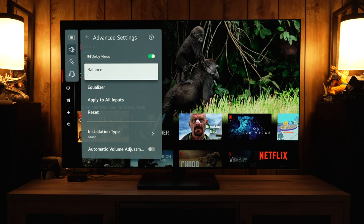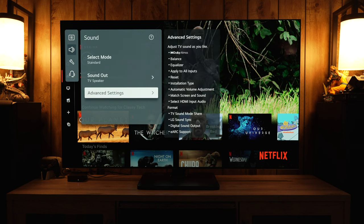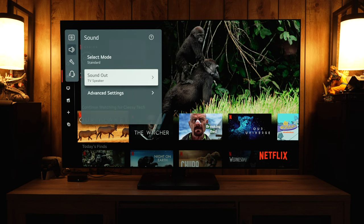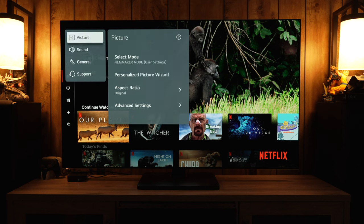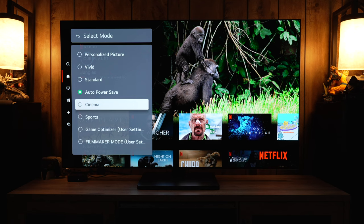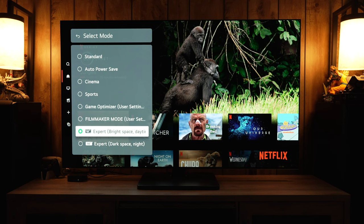If you go to Sound and you have external speakers, an AVR, or sound bar, this is where you go to turn on eARC and set the digital sound output to pass-through. The options are grayed out here because I was using the TV speakers. You can also see where you switch the type of sound output. If you are using TV speakers, AI Sound Pro works pretty well. Now we're going to get into picture settings — if this seems too fast, feel free to pause or slow playback to 0.75x.